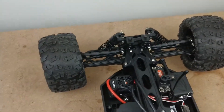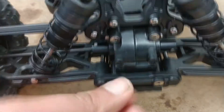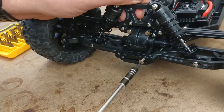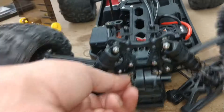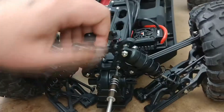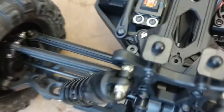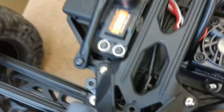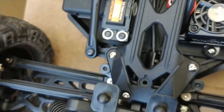But the bearing has just popped right back out again, so I'm going to look to get this fixed. Here is the 10MT now with its shell on. The issue was with this front differential — the drive shaft, like the output drive cup, when the car would run even a little bit, that would push out and there was a bearing that would poke out.